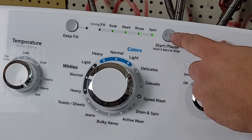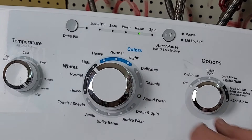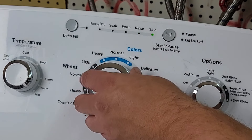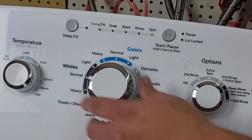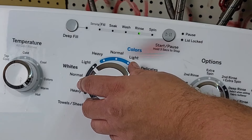If you want to go back through the codes again, simply press the start button and it will revert to the first fault code stored. If you rotate the knob, it will kick the system back to diagnostic mode and advance the selection forward or backwards depending on which way you go. To exit entirely out of diagnostic mode, press and hold the start button for 3 seconds and the diagnostic system will shut itself down.